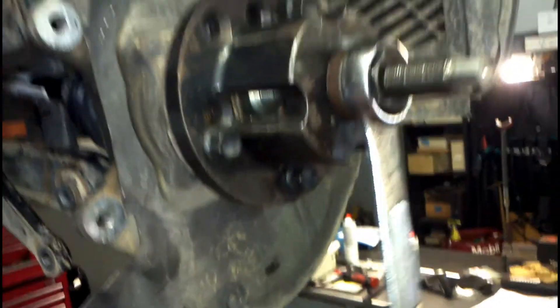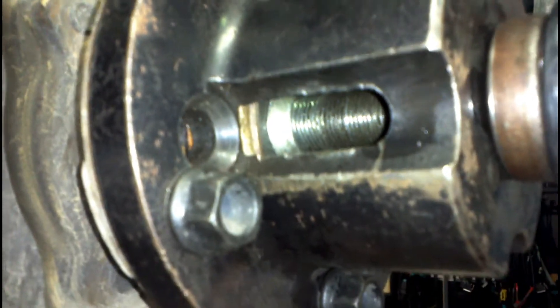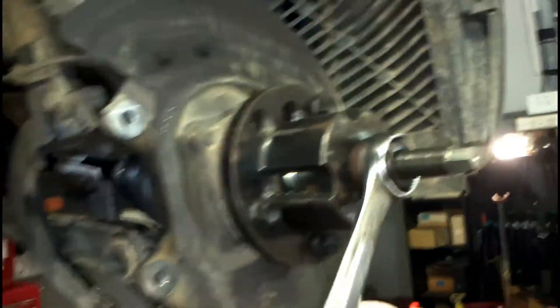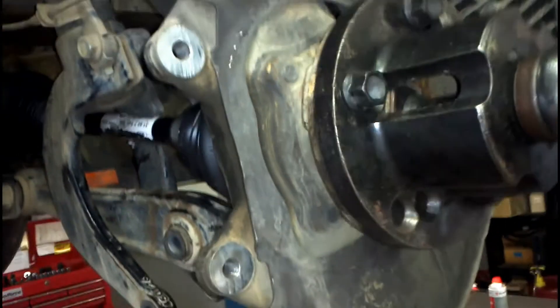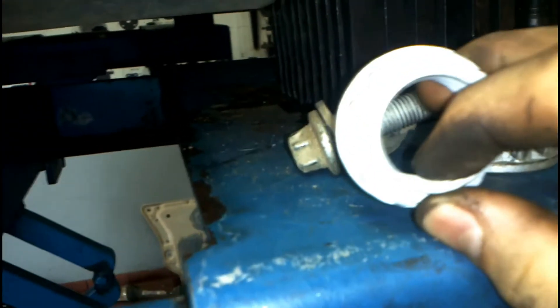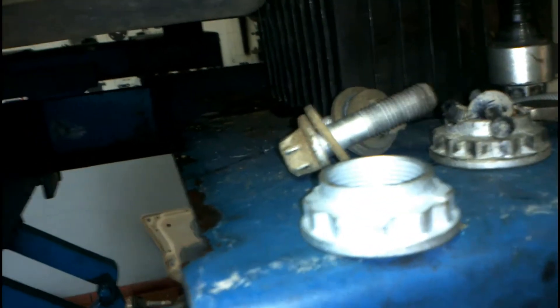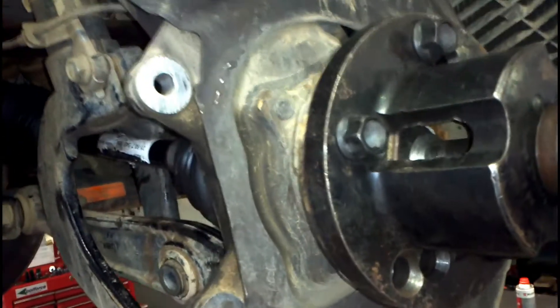We're going to put the belly plate back on. This is the apparatus for pulling the shaft back through — it's a 32mm nut on the end of that shaft I showed you earlier. You just wind that in. It's coming pretty easy because I cleaned it up and greased it up. You've got to use your brand new 36 double hex nut and just bash the insides of it where you find the little cutouts of the shaft.